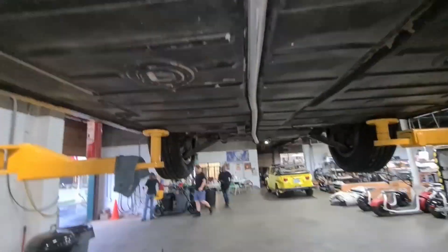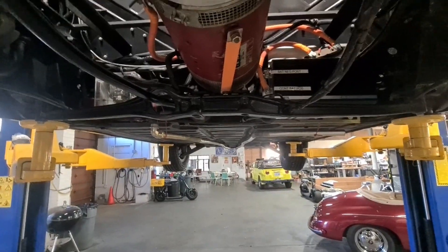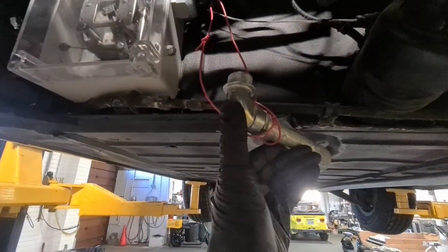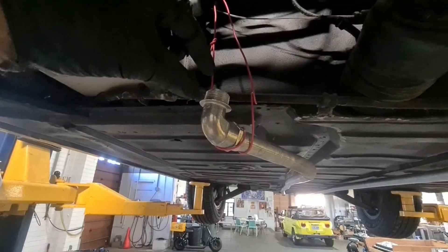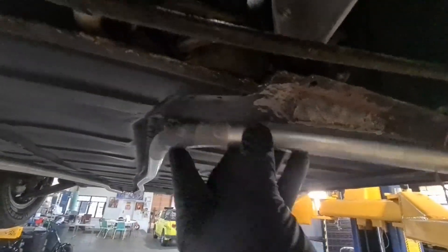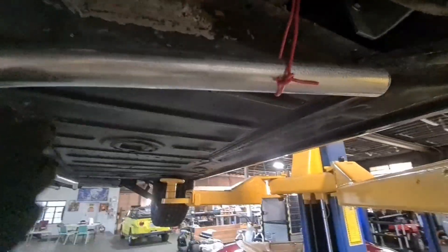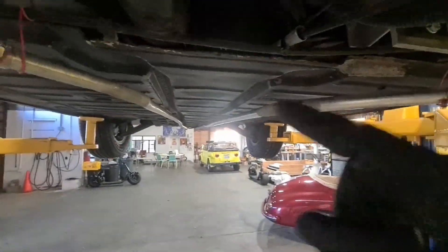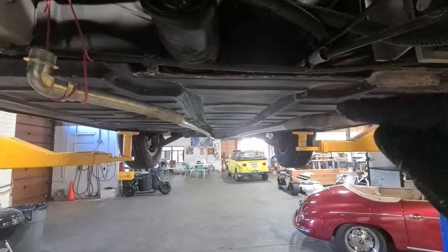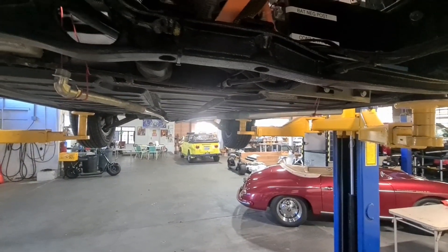All I have to do is put the brackets on and then make another one which is a mirror image. I'm calling this section of the conduit bending complete. This one will go here and it has the 90-degree fitting, and I've designed a small 3D-printed adapter which will then go to a gland nut to take the wire up. The other one is going to go here to catch a path north. I can't actually mount them yet because I need to pull the orange cable through, and I don't know how long it needs to be because the batteries aren't in their final positions. So we'll wrap up this first section of the piping until after the battery installation.